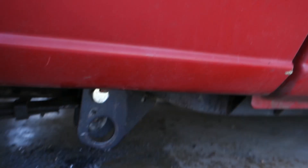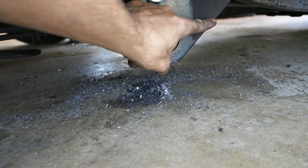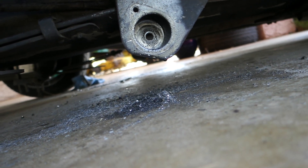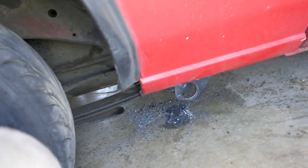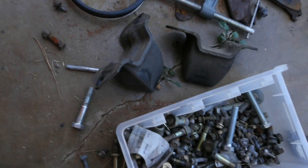What's left is on these hangers - you can choose to do this or not, but you're probably going to want to. We are going to cut from here over and cut all the rest of this hanger off because that's definitely going to scrape. There's maybe two and a half, maybe three inches between that hanger and the ground. We got the bump stops off. It's low on this side - at least we got one side looking good. Yeah, we got to figure out what's going on.